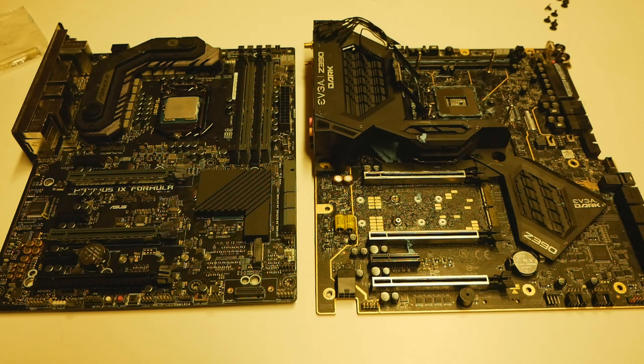Then when it comes to memory, the difference was really huge. Of course, when you look at the motherboard layout, the difference is really obvious. I used the same memory sticks on both of the boards, or well, I have run these memory sticks on the Dark for over 1 year now. So I used the HyperX Predator 4133 CAS19 sticks, and I tried them on the Maximus 9 Formula. I only set the main timings, so 17, 18, 18, 28, command rate 2, and all of the subtimings were at auto, 1.25 on system agent and IO, and memory voltage ranging from like 1.4 to 1.5. Setting more than 1.5 usually does more harm than good, so it often just makes the memory even more unstable.